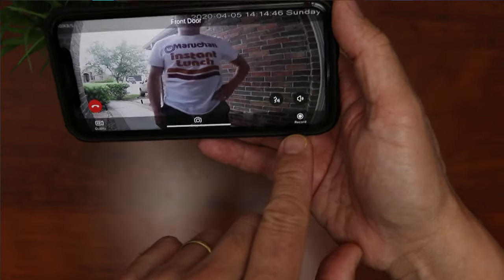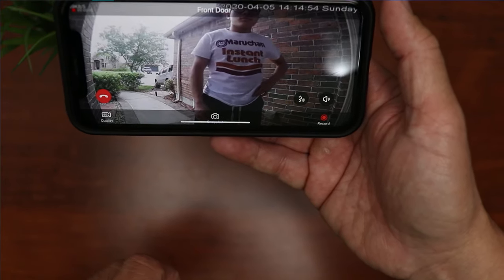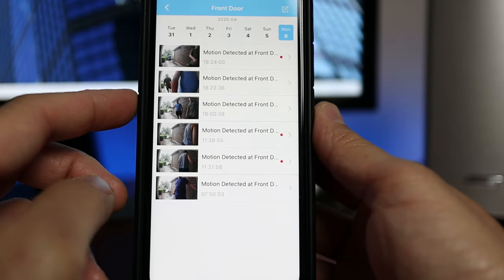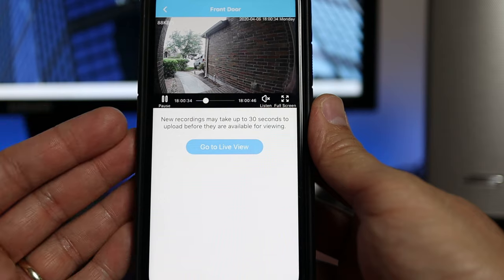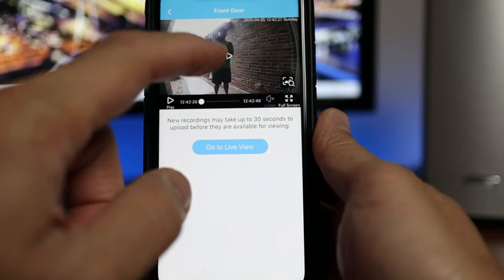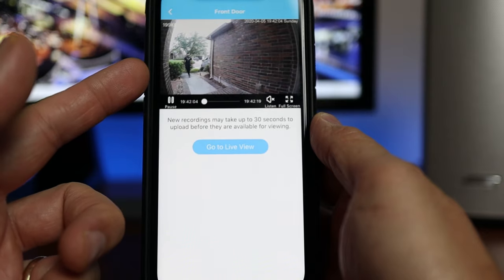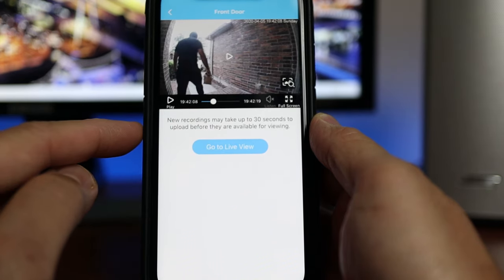I realized that when you answer the doorbell press, the recording will stop — just like with the Eufy video doorbells when they were initially released. But Amcrest knows about this and added a record button when you answer the doorbell, though this is an extra step. And even if you hit the record button, it will only record the doorbell side of the conversation and not the phone side. As to motion recording, the Amcrest video doorbell has a 3 second pre-recording which they didn't advertise. In the footage, you can see that when going out of the house, the camera started recording before the motion sensor was triggered. Even with issues with motion zones, the doorbell has been reliable in motion detection. However, due to the short 16-foot range of the PIR sensor, most motion events of people coming to the door will start when they are already in the camera frame — which is why I initially thought there was no pre-recording.